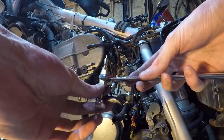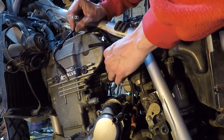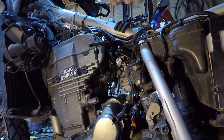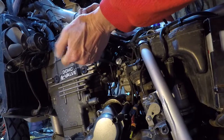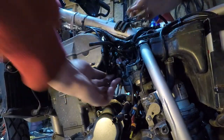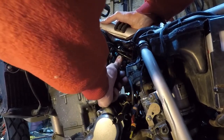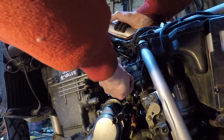It's a 13-millimeter wrench on the body of this unit, so we'll thread it in now — get the old one out of the way and remove it completely later. I don't want to over-tighten anything, so I'll just thread it in to the bottom and give it a little snug. Probably good enough. Pull it out, push it in — it doesn't go all the way in, but perhaps it's seated in its bore. Let's try and start the bike.